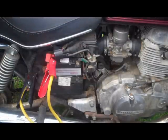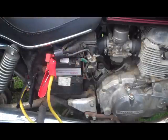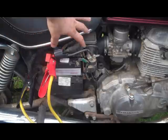Sometimes you'll have a motorcycle where you can't really get to the battery. The battery is way under there and the terminals aren't readily available. So something you can do is ground out to the frame, just like this one is, and then find the hot side of the starter solenoid.